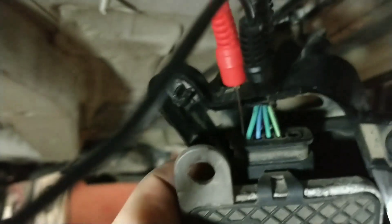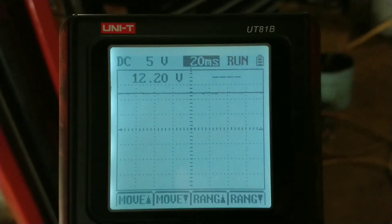The other side of it that goes to the car has only got four wires - got the two outer ones for power and ground. I'm not sure on it - battery voltage, ignition voltage. The center two are two and a half volts.